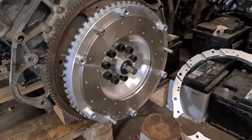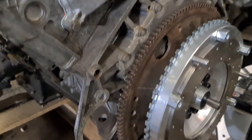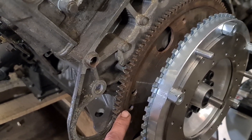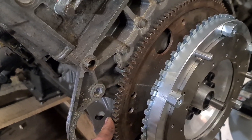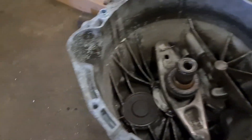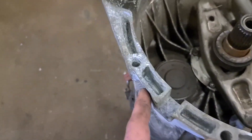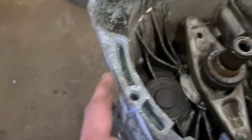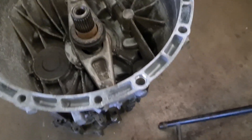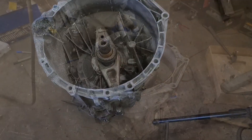This is where we're at with the V8. The PMC flywheel is on — this is a 740, so it's the M60B40 flex plate off an automatic. You need to use this along with an automatic starter. The next problem we have is locating the crank sensor, so we have to take a bit out of the bellhousing down here, and also where the starter is going to mount — we have to cut that out too. I'll show you that once it's cut out.